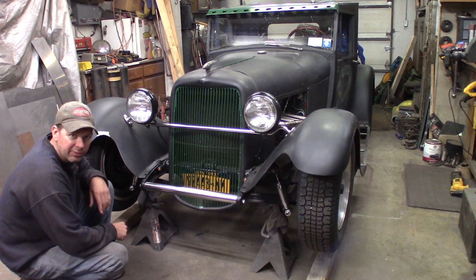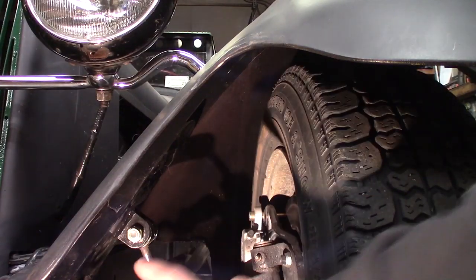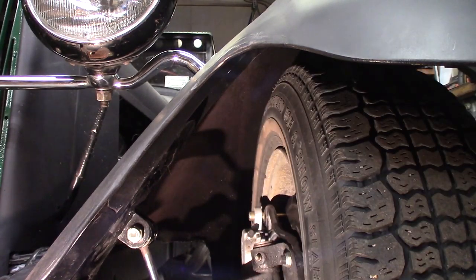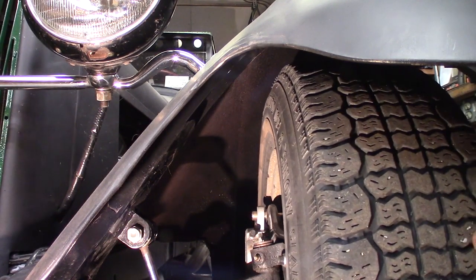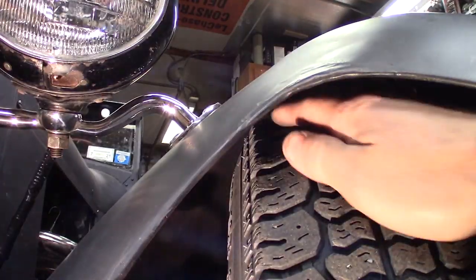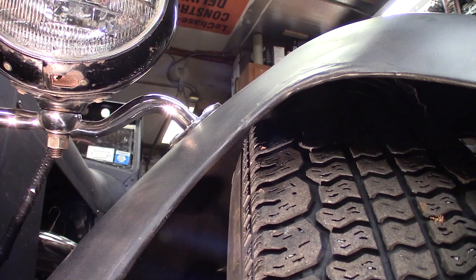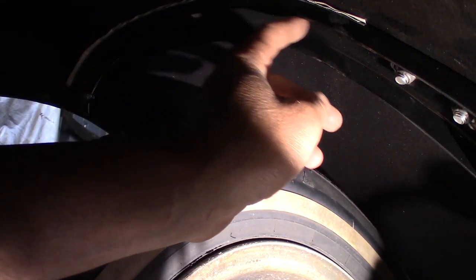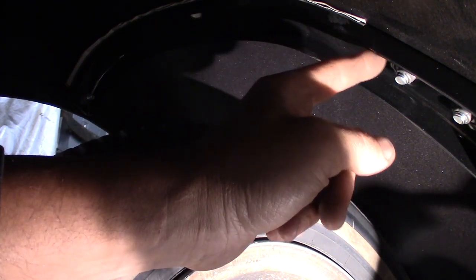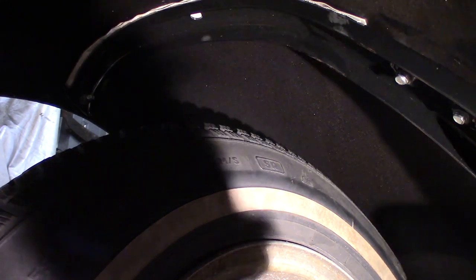But I do need to send them in for the recall. Right here we got the fender brace, and when it's hitting, it's hitting right up here over the tire when I turn the wheel. It hits the brace. On the passenger side you can see the brace here — you can see where the paint has been rubbing where I hit the grooves on the side of the tires. So it's definitely an issue.